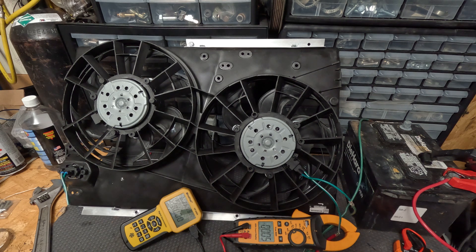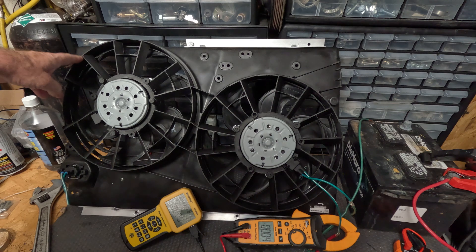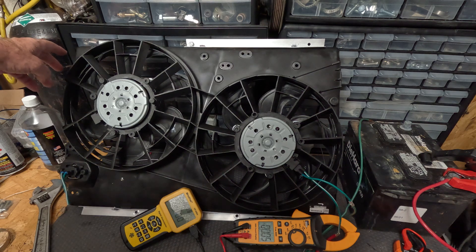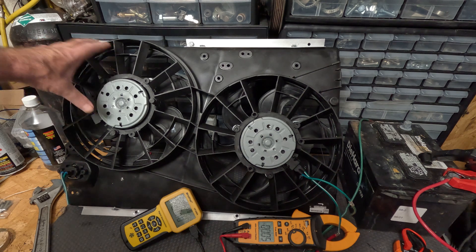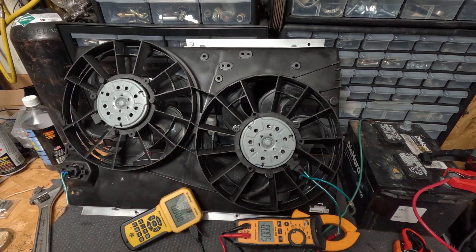If you're using it on the 94-95, you can factor in the shroud coverage in addition to the CFMs. The Contour's a cross-flow with tanks on the left and right, so the fan is optimum for those because the coolant comes in from the top and flows that way. 79 and later Mustangs are also cross-flow, but they flow from right to left, so that's not perfect, but I don't think it amounts to much. Let's start it up and see what we get.